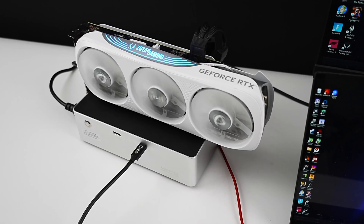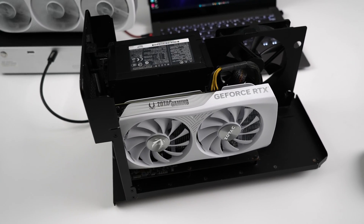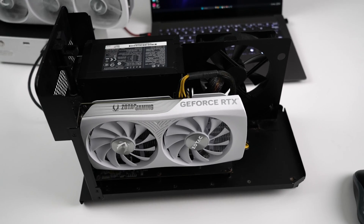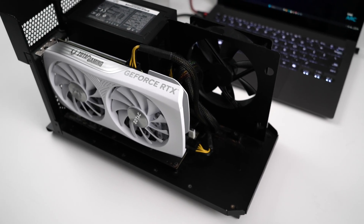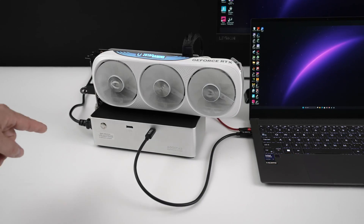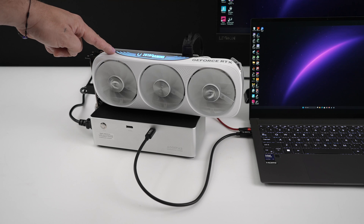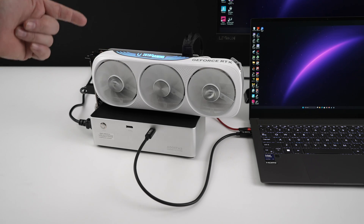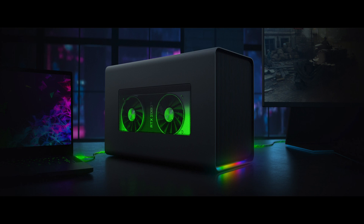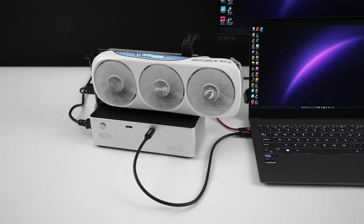I've got a couple that I tested, and initially I went with one of my favorites — the Razer Core. This has kind of been my go-to. It is Thunderbolt 3, so it's only going to run up to 32 gigs, and it looks like it's not even running that fast over these new Thunderbolt 4 connections. The eGPU I personally went with is the new AUSTAR AG02, which has USB 4. Price on this isn't that bad — it's coming in at $199, and it's got a 400-watt power supply built in. It's an open eGPU setup keeping the price down, and overall when it comes to speeds over USB 4 or Thunderbolt 4, it definitely beats out that Razer Core by quite a bit.